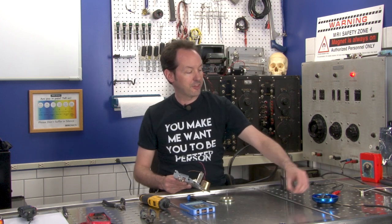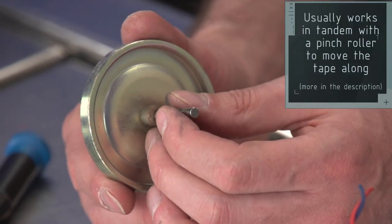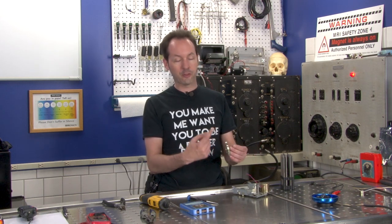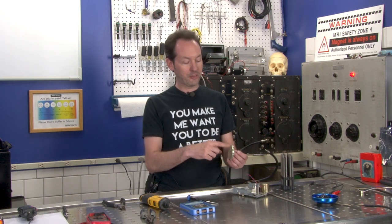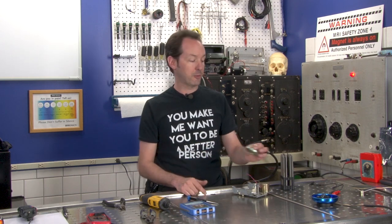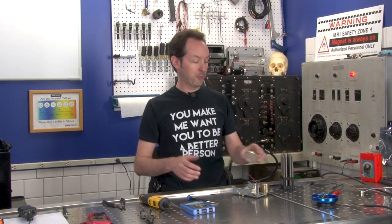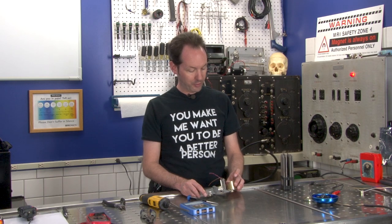As far as tape goes, this is about as simple as it gets. Here's our capstan roller. The purpose of the capstan is to establish playback speed — that's what a capstan does. You'll see this in anything that uses tape. The motor spins at a precise speed on a precise-sized pulley, and this spins at a very specific speed. As long as all those things match up, it'll play at the same speed all day long. However, if you change the speed of the motor, it'll play at different speeds. So we've got the motor here, which is just a 12-volt DC motor.